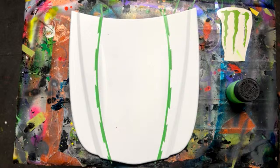Okay, someone said, how transparent are the pigments? Do you think if I was to lay a silver flake down and put the pigments over, it would work with candy? No, it won't. Nope. You're going to need a candy toner for that. You could use it, however, to accent and do some other things like that. But if you're planning for it to look like a candy, don't do it. Candies are in the works, yeah. But you can get candies from House of Color, Tamco. You can get them at one of those.